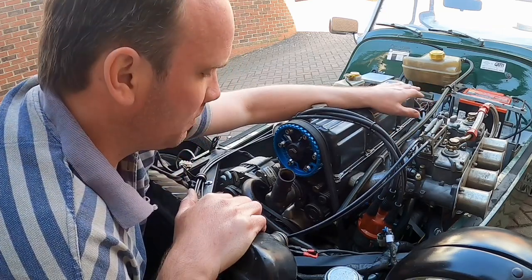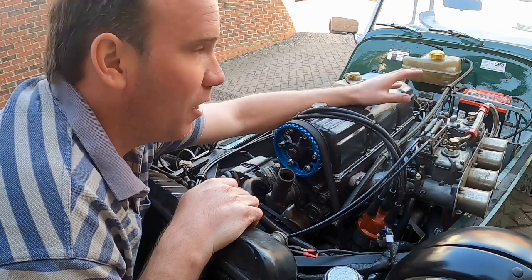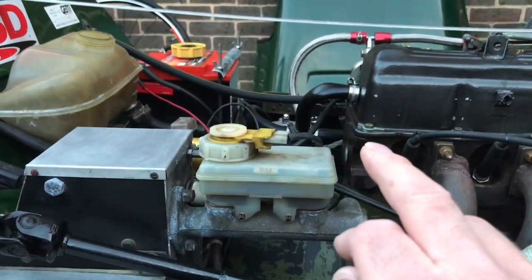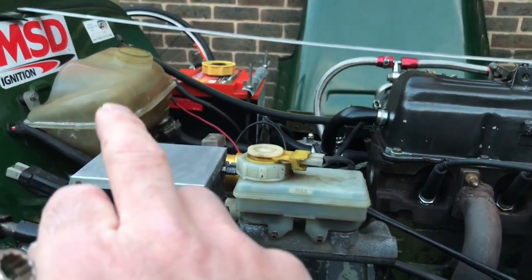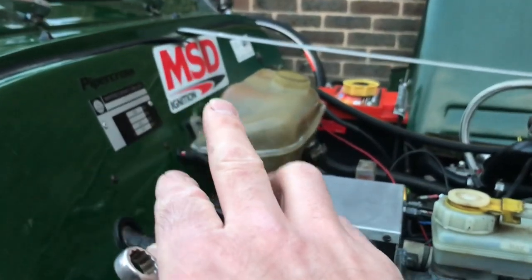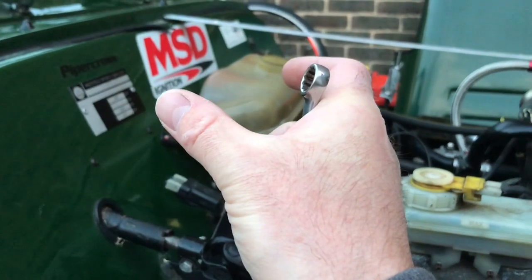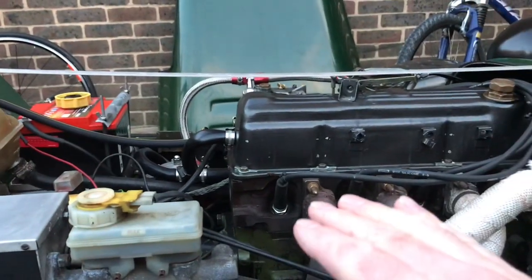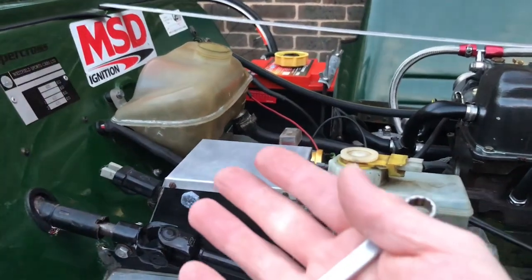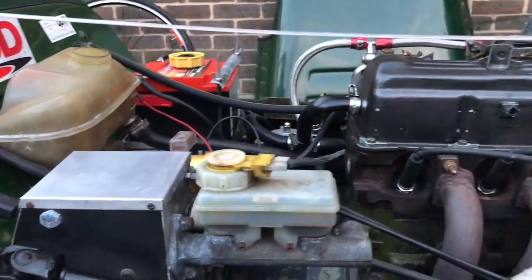And it won't allow the water to fluctuate and expand. When I put the water in, I just filled up the water from the header tank, and the header tank is low in the car. The top of the engine is actually higher than the bottom level mark of the header tank, and this header tank needs to come up. I put a straight edge along from the top of the bonnet through to the bulkhead. What I'm going to do is drill another hole here and come up higher - maybe 10 to 20 mil - and increase the height of the header tank. So when the water does rise there's still some room for the water to move up and down inside the header as it should. This potentially is a flaw, maybe when the car was built. This will certainly hopefully solve one of the issues I have with the car overheating.